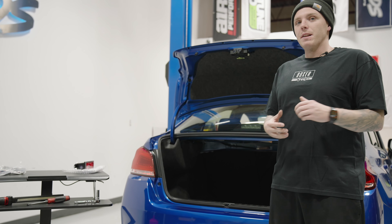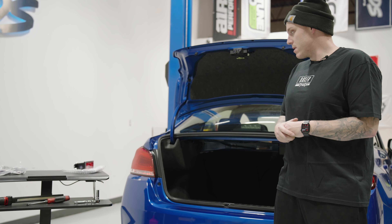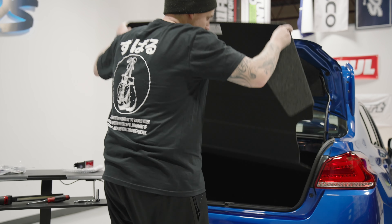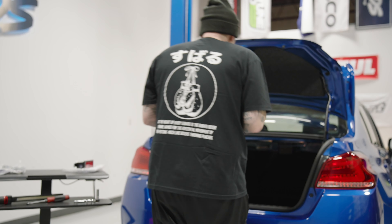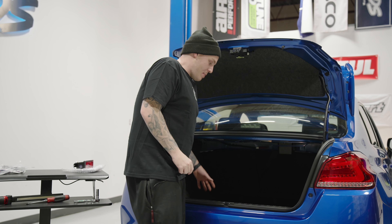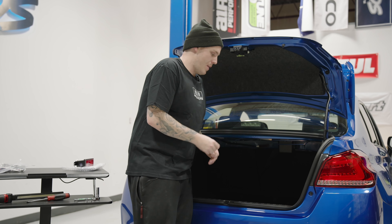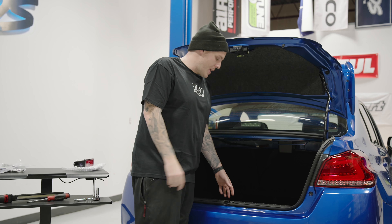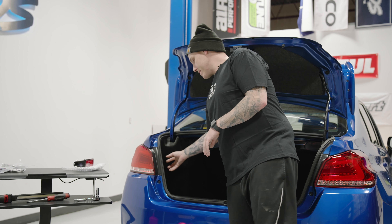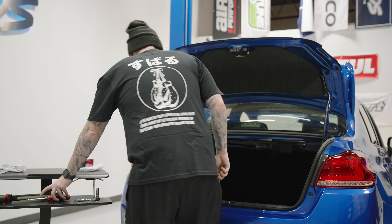So if you've done any taillight installation or anything in the trunk, you'll know we have to remove a couple pieces to get access to the taillight harness. We're going to go off the driver's side taillight harness. Basically we're going to start by removing this plastic piece — three clips hold it in. Be very careful with these; they have a tendency to break, and this piece also has feet on the back that you may fold over, which is a big pain. Then we'll step around to this side and take this fender liner out. This plastic piece in the center needs to come out before you can get the whole fender liner removed, so we'll dive into it with the screwdriver.